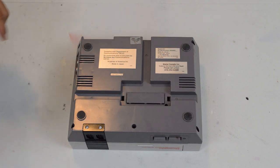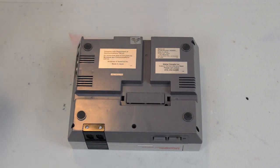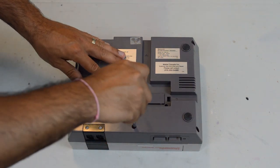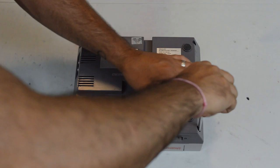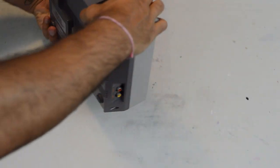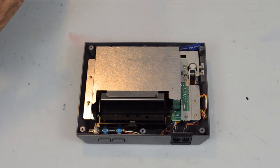What's interesting about the NES is there are only six screws holding it together, and this was before they started using game-bit screws on the consoles themselves, so you'll only need a regular Phillips head screwdriver for this one. You basically just have to remove the six screws. Now with all six screws out, we set those aside — including the two stubborn ones — and then all we have to do is lift the top part off.